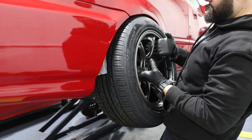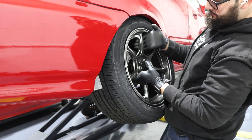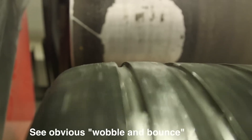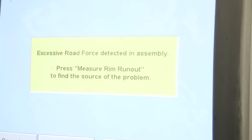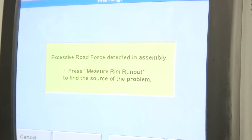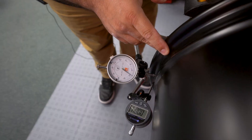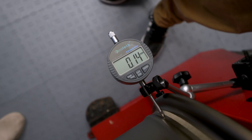If you've ever seen a wheel and tire get mounted, sometimes you'll see a visual wobble when a tire is on a wheel on a balancer. Now there could be a lot of reasons visually that it's appearing that way — it could be the tire being off, it could be some machining on the wheel — but does that mean the wheel is out of round? The answer to that is no. The important thing to understand is that out-of-round conditions are measured at the bead where the tire actually rides.